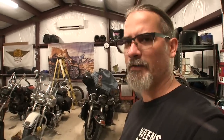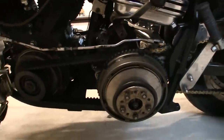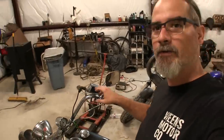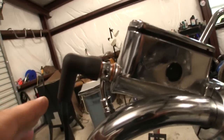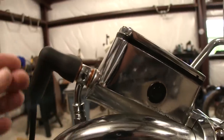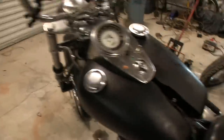I've got it all back together and this is what I've done so far — it looks like it did before I took parts off, except for obviously the open primary. My handlebars look a lot better all cleaned up. I kept really only a brake light and ended up running a banjo bolt pressure switch through here. I used a spark plug boot to protect the wiring — it does kind of look like an afterthought but you wouldn't notice unless I pointed it out. Eventually I'm going to put a bib here to hide all this.